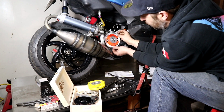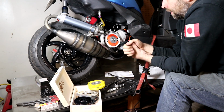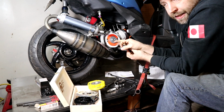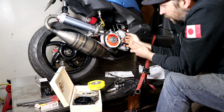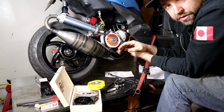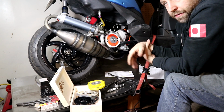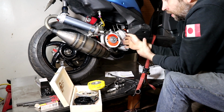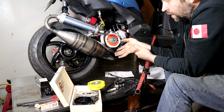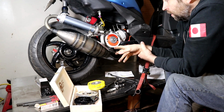So, what you want to do, again, because I know that where this one is, that is top dead center because I set it earlier to that. As you can see on this motor, I'm actually running it almost at 0. With a timing light on this one, it seems like I am getting really close to about 28 or 29 degrees on the low end, and then as I rev it up, the curve drops down to almost like 5 degrees or so. So that seems pretty ideal for this. But I haven't done any dyno runs and played around with it or anything yet. Dyno is still a work in progress. I have some stuff I still have to figure out on it.